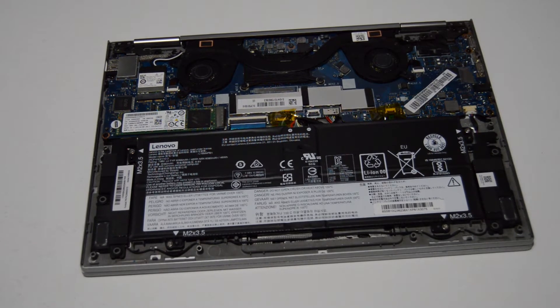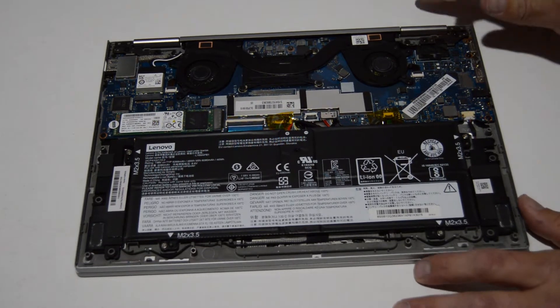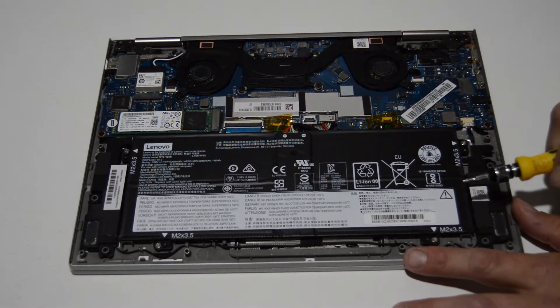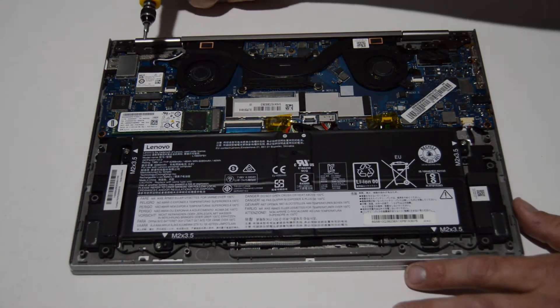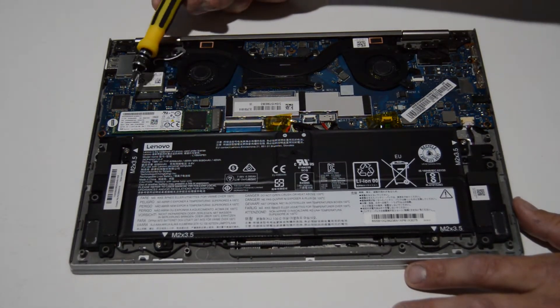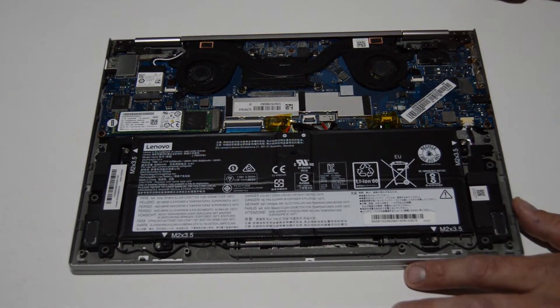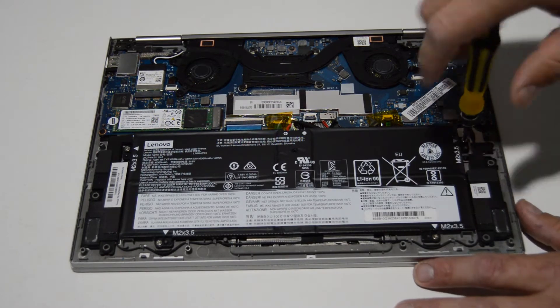Let's take a look at what we've got inside. The rest of the fasteners are a small Phillips bit, so we're going to switch to our 2.5 Phillips. Generally, the first thing we want to do for disassembling is to disconnect the battery and remove it. But if you're just replacing your Wi-Fi card or your SSD, as long as you don't drop something metal onto those contacts, you should be fine. As best practice, we'll go ahead and remove the battery.